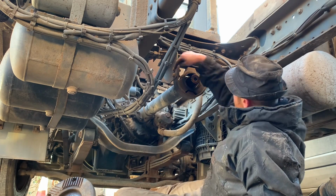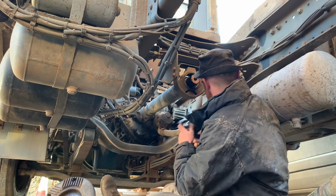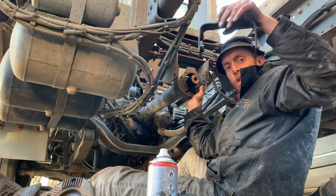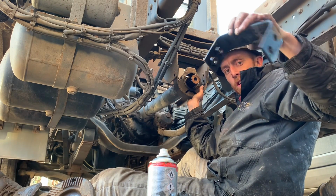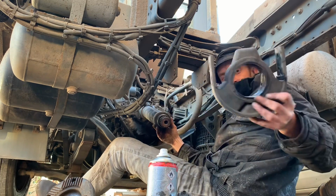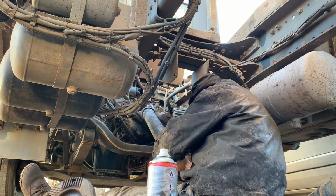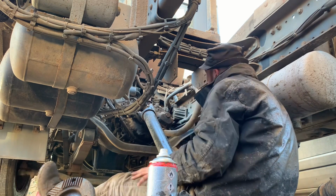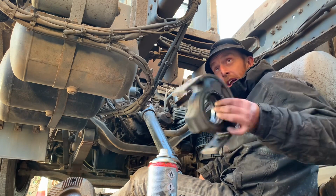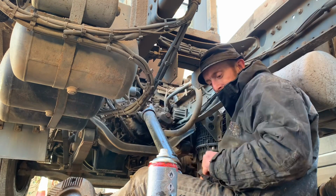Right, now we have to take these 4 bolts out here. Get my little whiz popper again. Remove that, look, they're captive nuts in there, welded on. There's the foot one. Oh, is it like a bearing or something? Yeah, this is a prop shaft centre bearing. It holds the prop shaft up in the middle. Oh yeah, it is, and it's collapsed, look. Well worn out, isn't it?